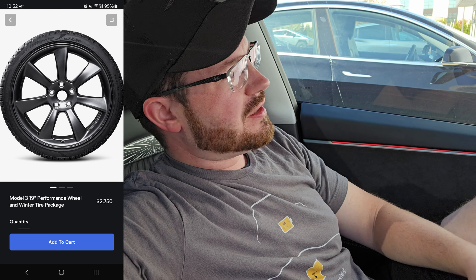Kevin here again — been a while since I've done a Tesla video, but I've been absolutely loving the car. I have almost 12,000 miles on it and no issues to speak of. Up here in New England it's almost snow time, so I needed to get a set of winter tires. I decided to try the new set Tesla released on the Tesla shop — the 19-inch performance snow tire set. It's a staggered 19-inch setup: 235s in the front and 265s in the back on the Pirelli P0 winters. It's a performance snow tire, so it'll handle in the dry a little better than a regular snow tire, but won't be quite as good in deep snow.